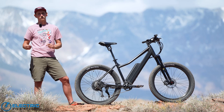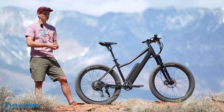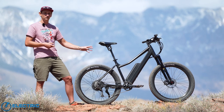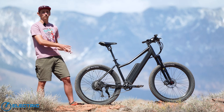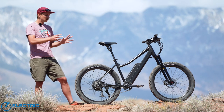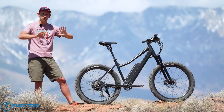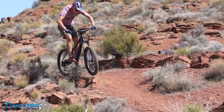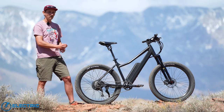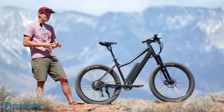Now this motor works and does a good job, but there are some things to note that are different from mid-drive electric mountain bikes — and really these are the reasons why mid-drive motors are more common. The first is weight distribution. By having the motor in the center of the rear wheel, you're shifting your center of gravity further back. Mid-drive motors are mounted in the bottom bracket — they're in the center of the bike, very low — giving the bike a low center of gravity and more neutral handling. This rear motor isn't a huge issue you notice all the time, but if you ever get the bike in the air, lay the bike over in a corner, or need to pick your rear end up, that's when you'll notice that increased weight in the back and the center of gravity shifted just a little bit rearward. The torque sensor does a really good job of engaging the motor, but it's not quite as good as mid-drive motors — though it's going to be much more affordable.